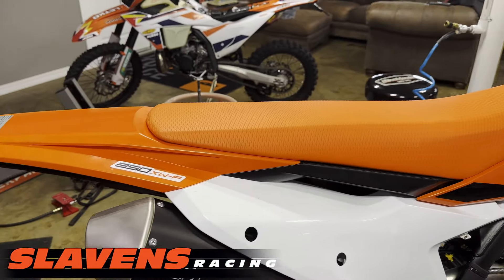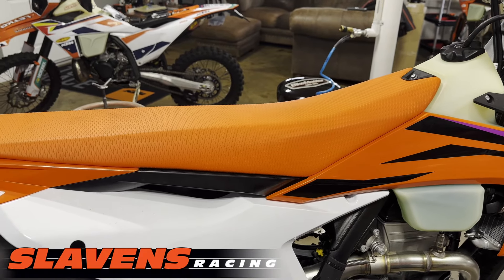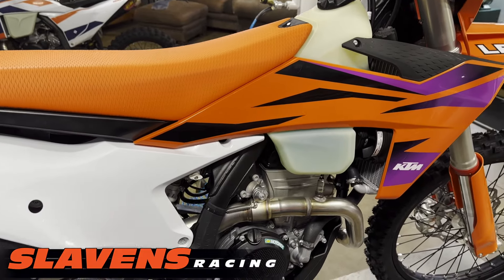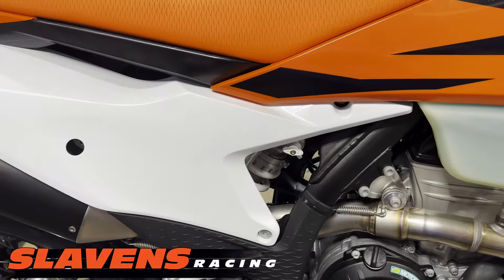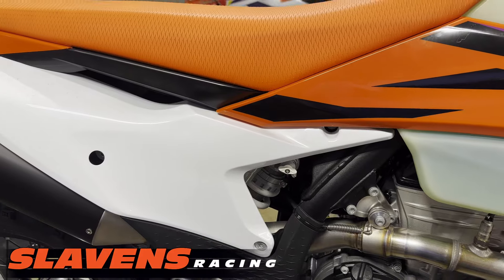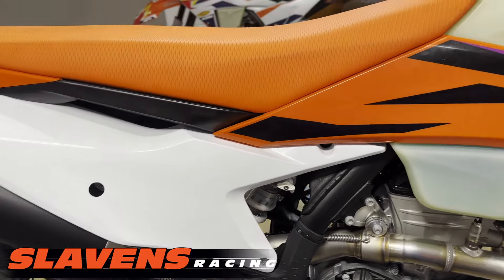The seat is new as well — the way it fits on is different, but it's the typical board seat, so I'll make my backside happy with a Seat Concepts seat. The rear shock has had some internal improvements and they've added external adjusters you can turn with your fingers, but they've also made dampening adjustments to the shim stack on the inside. I'll be changing that as well.